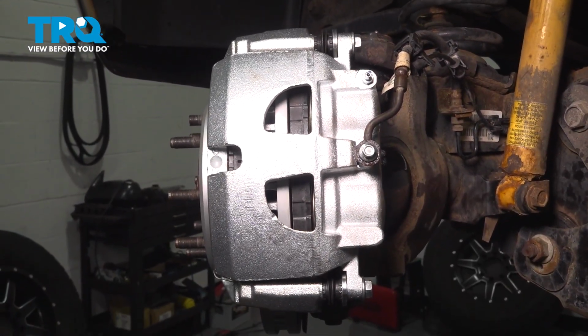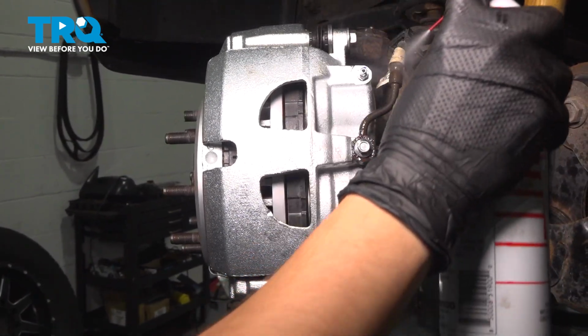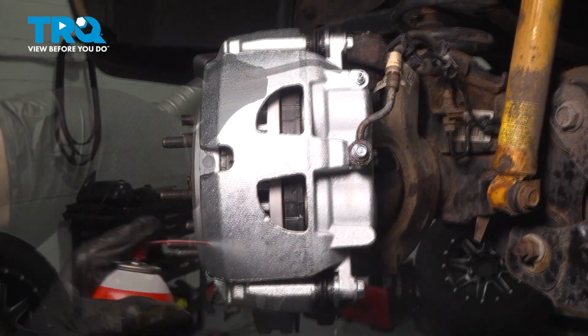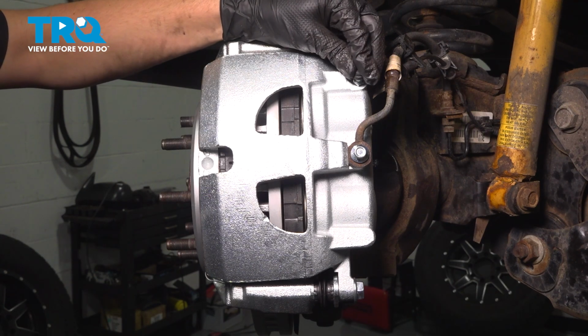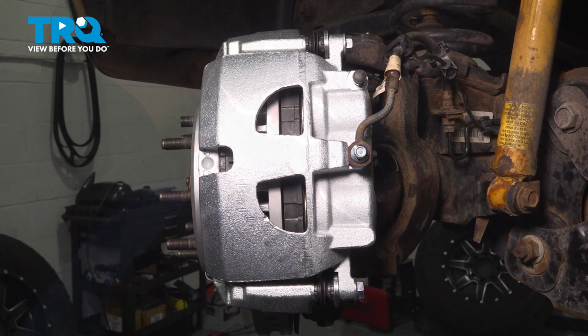At this point, once you've performed your manual brake bleed, clean everything off. I'm going to use some brake parts cleaner as well. Rinse it. That way you don't confuse the residual fluid for a potential leak in the future. That would be dangerous. So get this all nice and dry. Don't forget to cap off your bleeder screw. Pump up the brakes, top off the master cylinder, and let's get the wheel on.